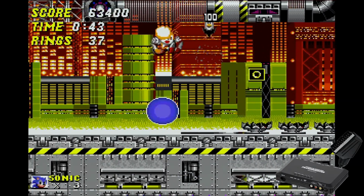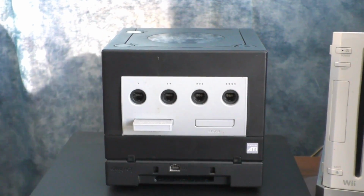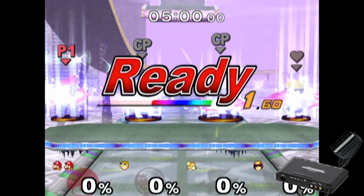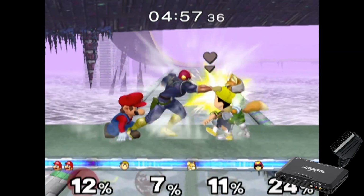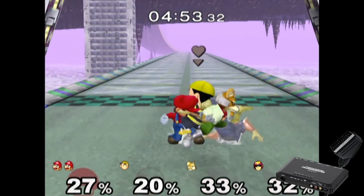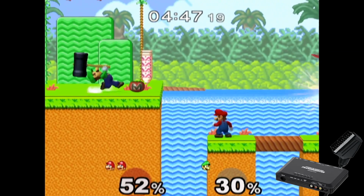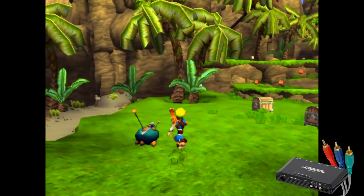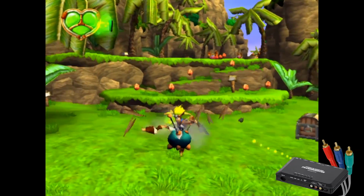And finally, PAL Region GameCubes natively support this RGB signal, meaning that I don't need to spend $300 on component cables, do any modification, or settle for S-Video. The GameCube being my most neglected system, primarily due to the price of games and small number that I own, makes me really want to get into this system now, seeing how it looks. The Framemeister is said to do less of an amazing job with 480 content, but it's still a major improvement to what I've had previously.